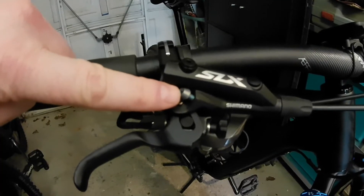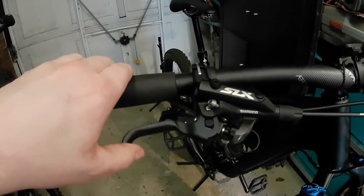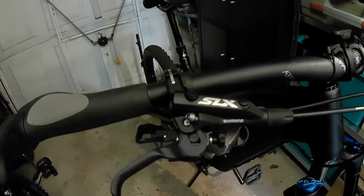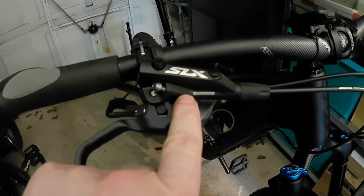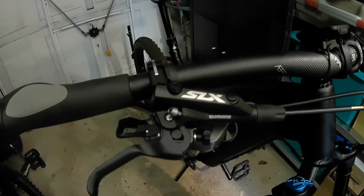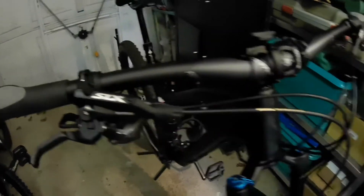The hack that we are talking about is this little fella right here, which is a four millimeter cap screw. That actually adjusts the bite or throw of the actual brake lever while you're braking. The SLX doesn't currently allow you to do this in its default form, but it does include the same internal mechanism of the XT brake, so by performing this hack you're effectively getting XT brakes but significantly cheaper.